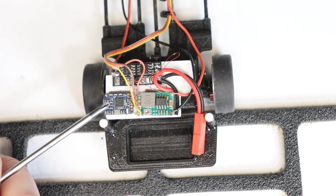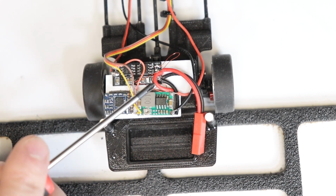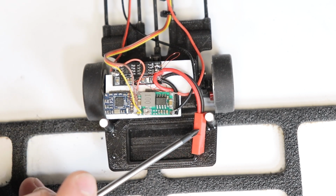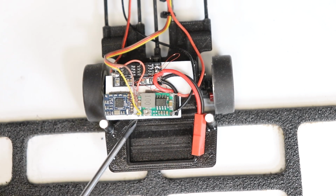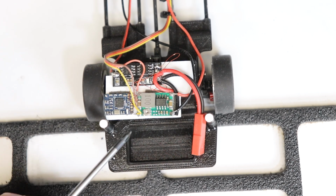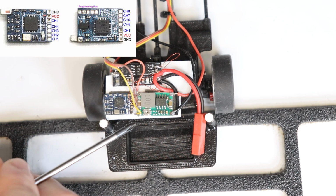The steering servo and receiver, however, cannot. I'm dropping that down with this voltage regulator, positive to positive, negative to negative, straight from the battery. These wires here, in case you're wondering, are for the LEDs. You'll probe this end with a meter and adjust the potentiometer until the voltage is where it should be. In this case, I got it to about 4 to 5 volts, so I wouldn't be overpowering the steering servo. So coming off of the lower voltage side of the regulator, positive to VCC, ground to ground.